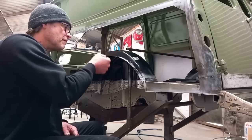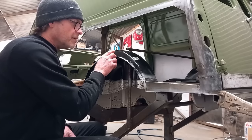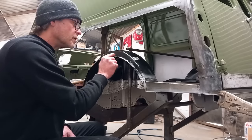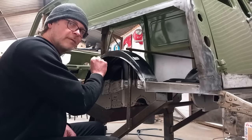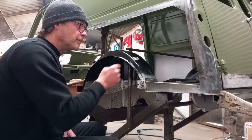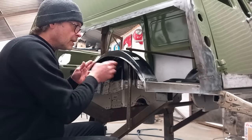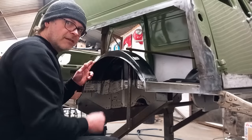So it sits further out and there's not enough space to get to the top of the replacement panels. Sometimes the flange is a little bit longer. This is one of the longer ones. And I need literally 1/16 of an inch. So rather than weld a strip of metal, I'm going to try something a bit different. I've got three points that I've measured, and I'm going to try and pull this flange out to get that 1/16 of an inch that I need.